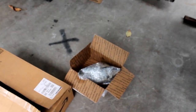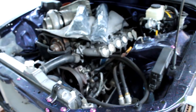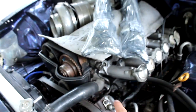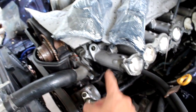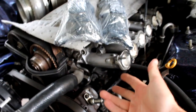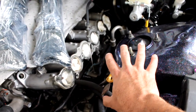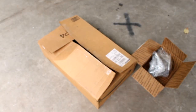The valve cover is still wrapped up, everything else is in that box. Vic went ahead and ordered the JDM power steering reservoir for the IS200. On NA-to-JZ swaps the reservoir sits right here directly on top of the pump, and while it gets in the way of the GTE intake manifold that runs straight forward — which is what we're using — it's going to mount up here in the strut tower in a factory location that'll clear the intake manifold and the throttle body.